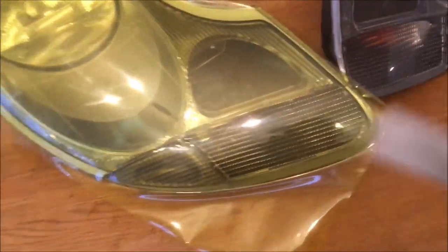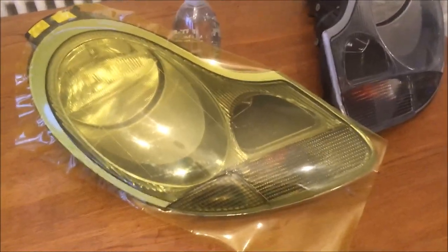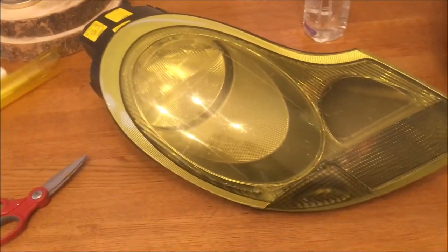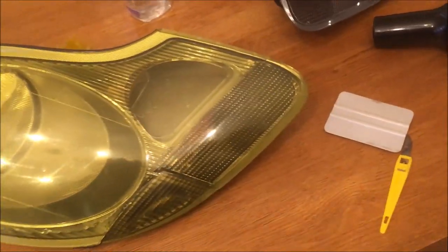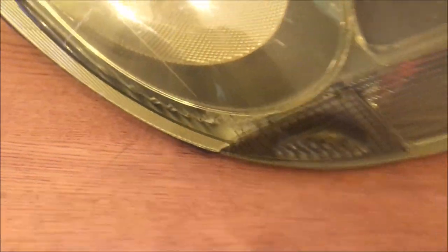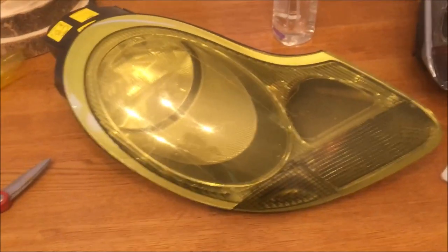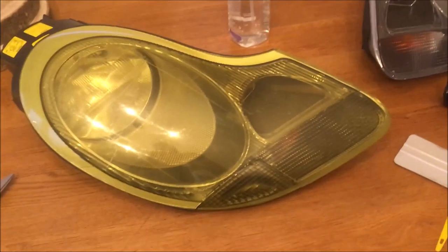Here's a quick look at the first light — I've got it pretty much where I want it. Next step is to trim, heat up those edges and get a nice cut with the craft knife. I've got the cut around the lens pretty much right now. I've put some heat around the edges and I'm just working out the last little bubbles — you do get some ripples around the edges that you need to try and work out. On top of the film there's a clear film on the back and a clear film on the front. I'm going to rip off the clear film on the front now and that'll give me a good view of where I'm at in terms of finishing up.